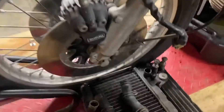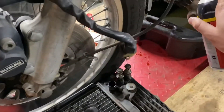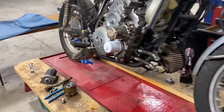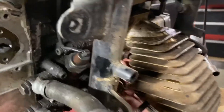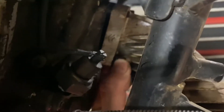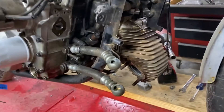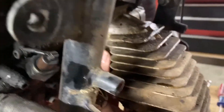Those on the main manifold right there are really rusty looking. Well, it's been a couple hours and the penetrating oil's had time to set. I've got the nuts broke loose on the exhaust manifold here and I'm just loosening up the last two. I went ahead and pulled the side pipes off, so we're going to get these two nuts off and see what we've got.